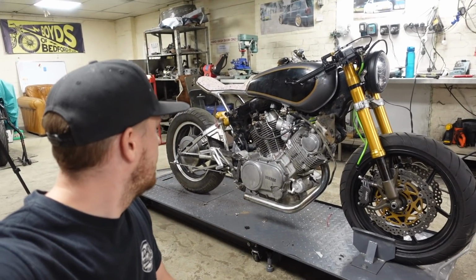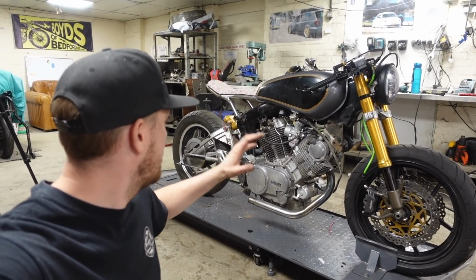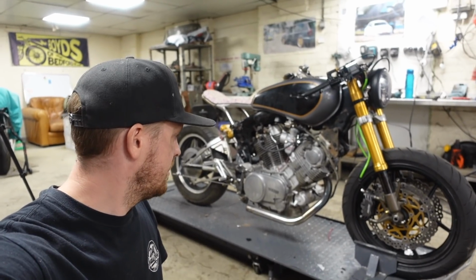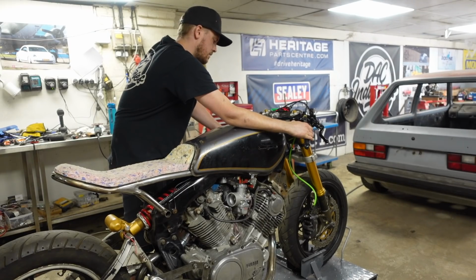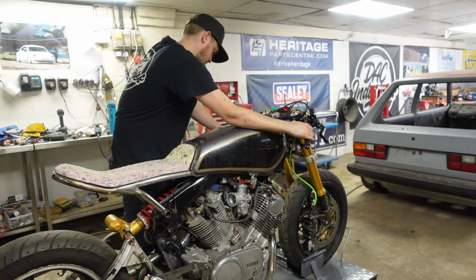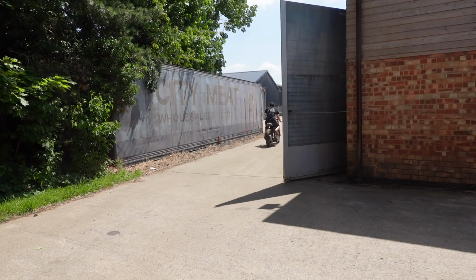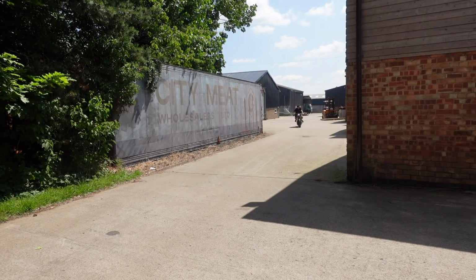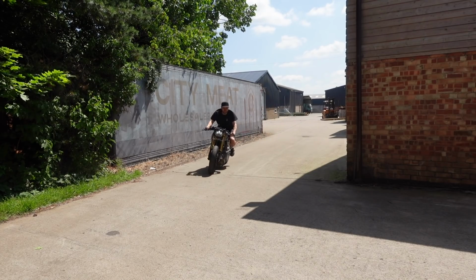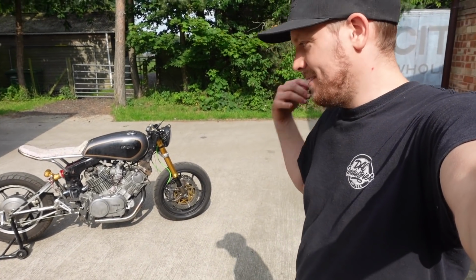And there we have it. All assembled. Pretty much that is, other than the exhaust, I think, the initial build done. So, now we've got these new carbs on, let's chuck some fuel in, see if it'll start. It runs. I got the HT leads in the wrong coils, that's why it wouldn't start when I first tried to start it.